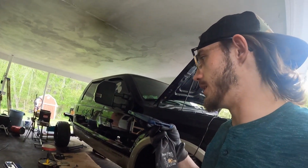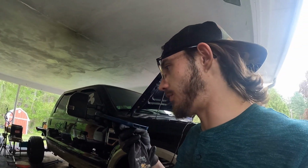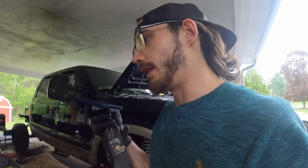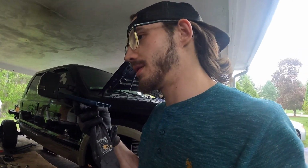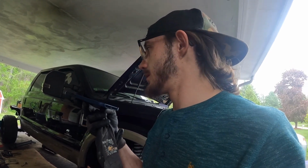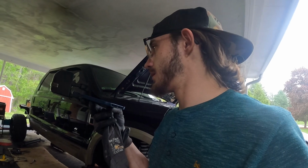Yeah, because it never locks up until it's going like 40 in third or fourth gear, you know what I mean? Okay. Well, those things do still have the adaptive learn all hooked up. You can't just get in and beat the hell out of it and expect it to shift. It's still learning your driving habits for a while. Yeah, I mean, I did... First couple hundred miles, so.